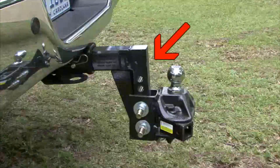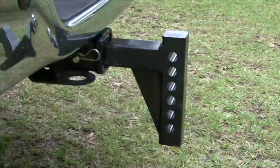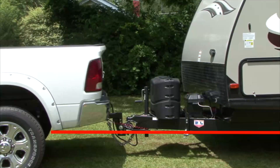With the hitch ball and coupler properly matched, let's talk briefly about the ball mounts. The ball mount is the removable part of the hitch that slides into the hitch receiver. For weight carrying hitches, it might be necessary to find a ball mount with a drop or a rise to help level the trailer when it's hitched to the tow vehicle.